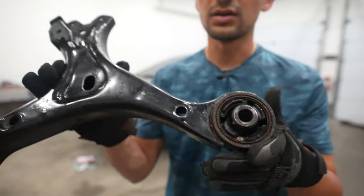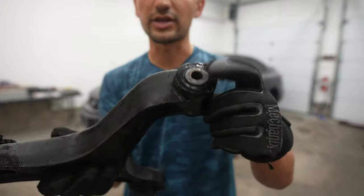In today's video we're going to be working on my Civic, specifically taking care of the bushings. Every 9th gen off the factory floor comes equipped with rubber bushings found throughout the suspension. The reason they use rubber is because it's soft, cheap, lasts a decent long time, and gives a nice ride. However, it has the most amount of deflection over any bushing you can throw on a vehicle. We're changing that out because we're looking more for performance.